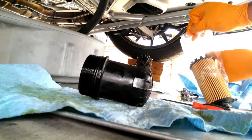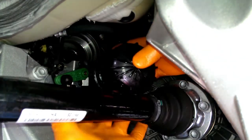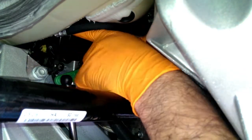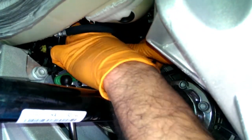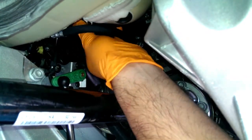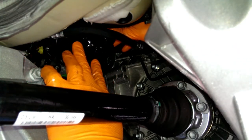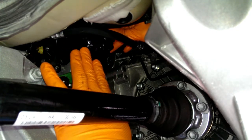Last step: take your brand new filter — I've got my preset filter installed in the canister. Just press, click, and here comes the fun part. I've already wiped the CV axle and the clutch line. Let's see if we can get in there smoothly. Go over the CV axle — in, through. I ended up just using my right hand to make sure the thread space between the lip of the canister and the flange was the same on both sides.